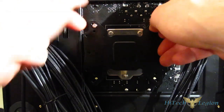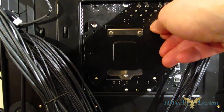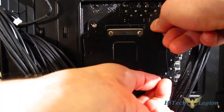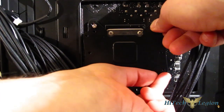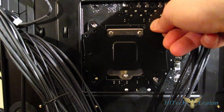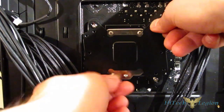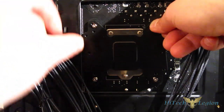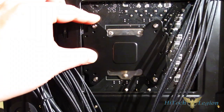Something to keep in mind: the kit does come with plastic washers, which are shims for higher pressure. However, it distinctly tells you in the manual do not use them at 1155/1156, as it will take the pressure out of spec for the motherboard. Once you've got all four screws through, you can move on to the inside of the case.